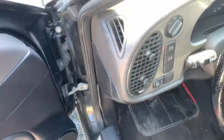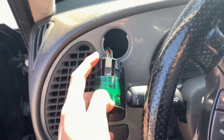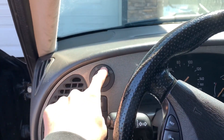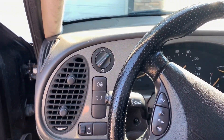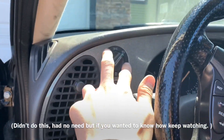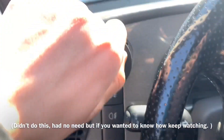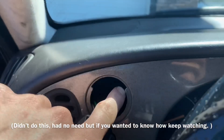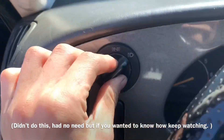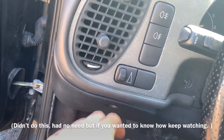For the actual installation of the boost gauge, I'm going to be replacing this headlight terminal right here — it simply just pops out like that. I'm going to be relocating this headlight terminal. I have HIDs wired in, so it actually doesn't do anything at all — it just lets me flicker my HIDs. I'll be relocating the wires down, cutting a hole right here, which is almost exactly two inches across, and routing power from the dimmer straight to the boost gauge.